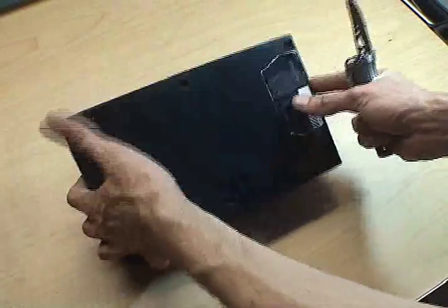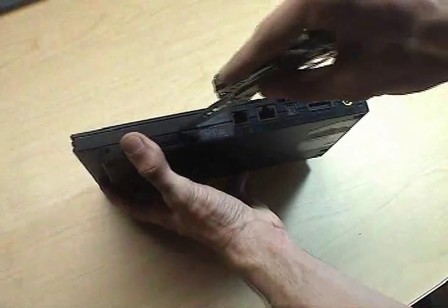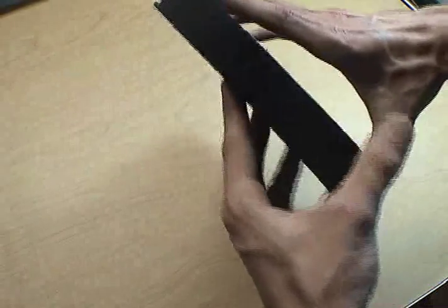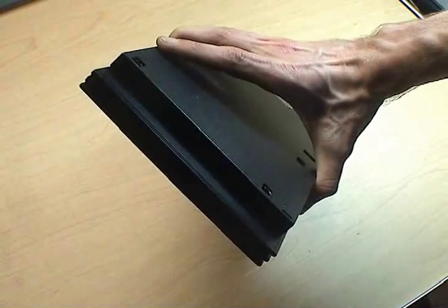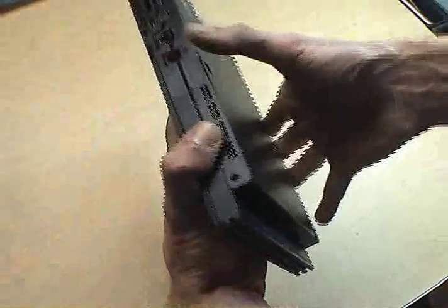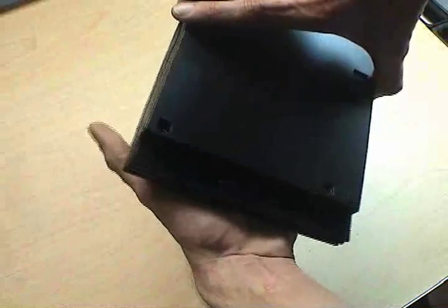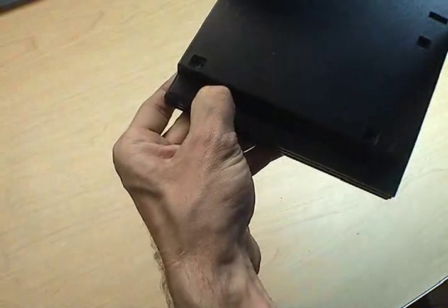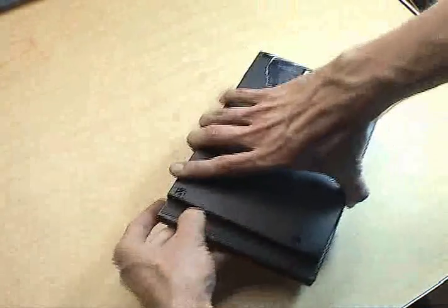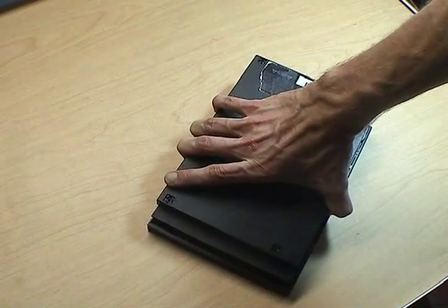After all six screws have been removed, proceed to the rear of your unit where you will see your official Sony warranty sticker, which we shall now void. You're going to want to start at the side that doesn't have the stair-step on it. Get your fingernail inside and gently separate it — you can see it came right apart. The stair-step side is a little more difficult. You may be tempted to open it like a book, but don't, because you can break it. Instead, notice there's a seam — get your fingernail in there and pry out, as the casing is clipped together.